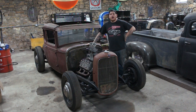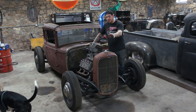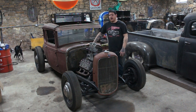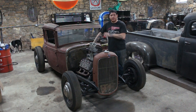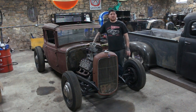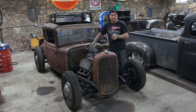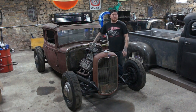The difficult part with this: if I wouldn't have channeled this car, we would have just used a stock 32 radiator and could have put it up on top of the rails and it pretty much would have worked. But my car is channeled pretty hard and I wanted to channel the grille as well to match, so my lines all match up. What that does is it makes the core quite small and causes some issues with the inlets and the outlets. I want to show you guys a cool little trick — if you want to make something like this using all old parts except for the core, you can do it with a little bit of parts hunting and it looks factory.